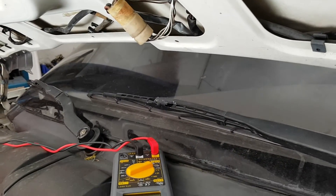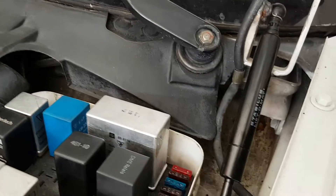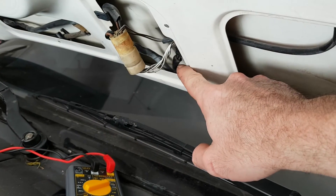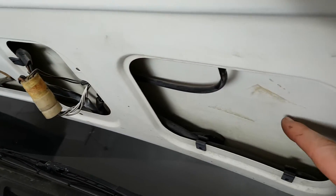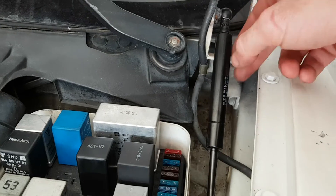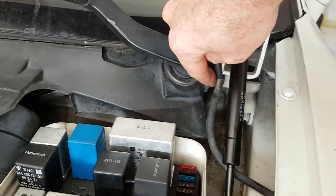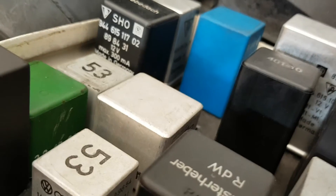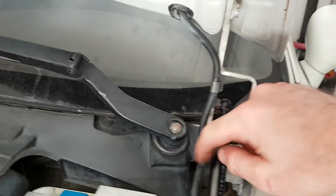For anyone looking for a potential short or wiring connection problem, this is where to look — it's this wiring loom. The wiring loom goes to the bonnet, to the heated jet nozzles, and all the way up to the top for the light as well. It runs down the corner of the hood and down through here. The bad connection is right next to this little clasp — and of course when you close the bonnet this doubles over. You can hear the relay clicking and it's right in here.